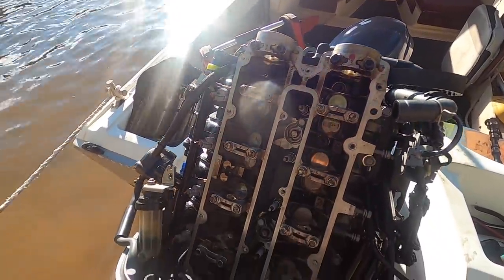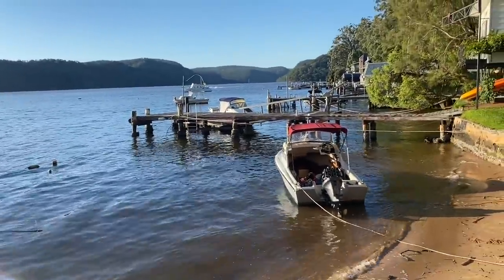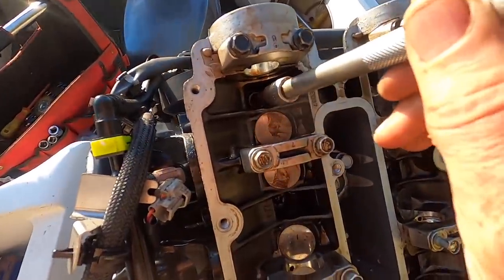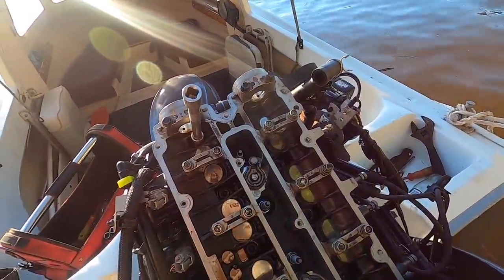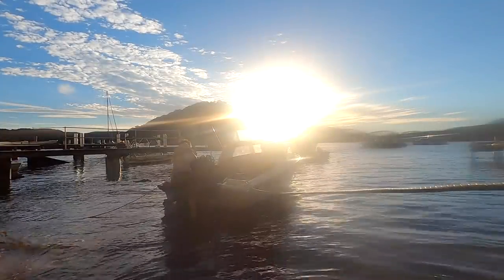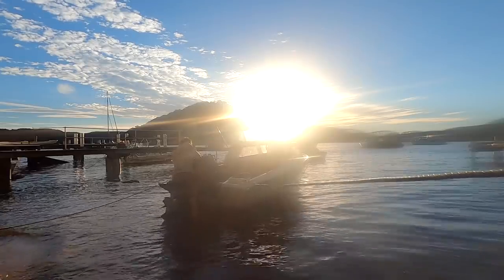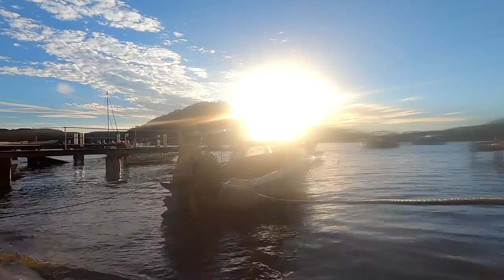I've got to go home and get some Torx bits for the ratchet so we can get these head bolts out. Running out of time. Got a bit out tonight, but hopefully these bits fit — I'm going to get this head off quickly before I go out. This is the bit I'm using: T55H. Seems to fit perfectly. So let's do it in reverse order, come into the middle. All the head bolts were very tight, but did manage to get them undone with the 3/8 ratchet in the end. Half inch probably would have been better, but managed to do with what we had.